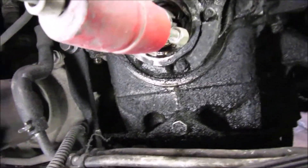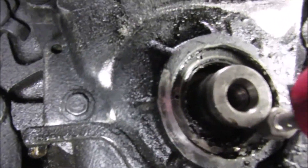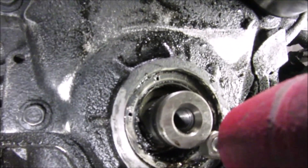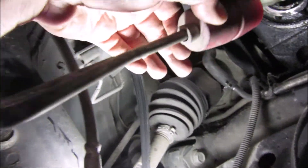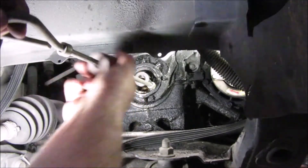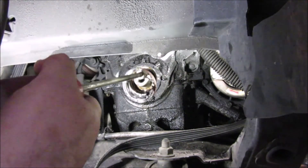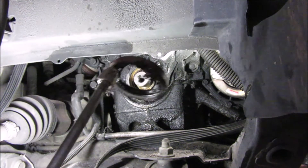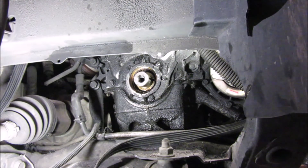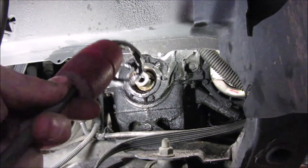So far I've come to this scenario: I got my little slide hammer with a screw on it — kind of the old school body trick. I've drilled a couple of holes in this and then we can slide back on it and pop this out. I only needed to drill one hole and it came right out. These little slide hammers are fairly cheap — I got this at a pawn shop about 20 years ago and it's been really handy for everything from bodywork.